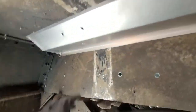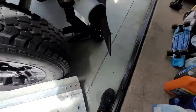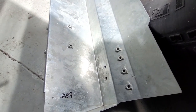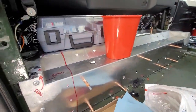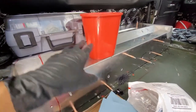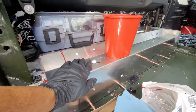When that's done, I'm not going to worry about grinding anything down here because this is going to be pressed in by these alignment holes that are going to go through the brackets here and on top. The threaded nuts are already welded on this lower panel — from YRM, that's panel number 289. It's already water-sealed so no water splashing up inside the tub will come up inside the vehicle. I'll just go ahead and add a little bit more sealer on the bottom.